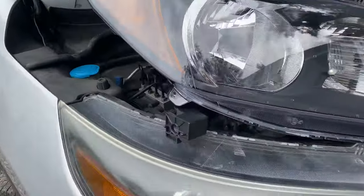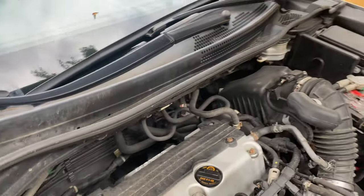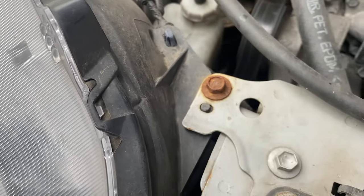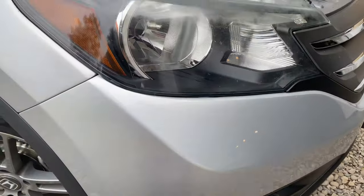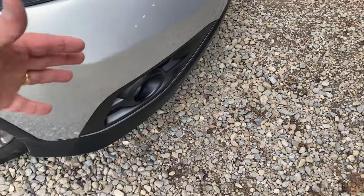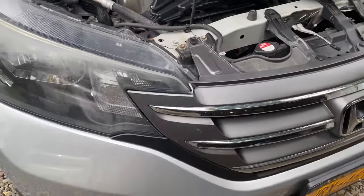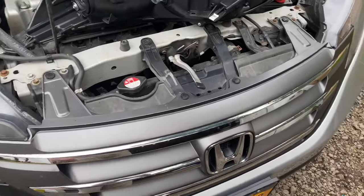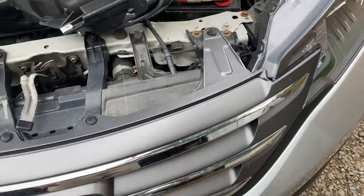Just by looking at this, I can see there's some type of fastener here, I haven't taken this car apart in this area yet. There's also a fastener here on top, and a screw tab right there — that screw I can actually see right here. What I'm hoping to do is release clips along this bumper cover and pull out and lower it, and that should give me access to what I need. But before I do that, because of the way this light tucks in behind here, I'm going to take off the center grille, starting with these four push clips.